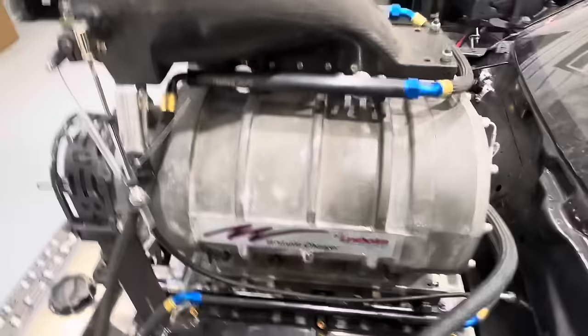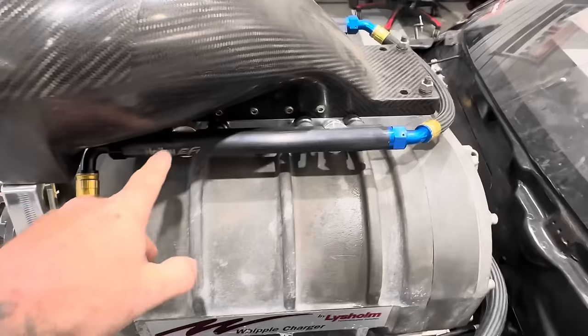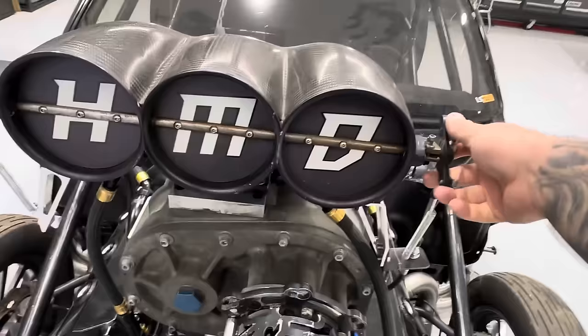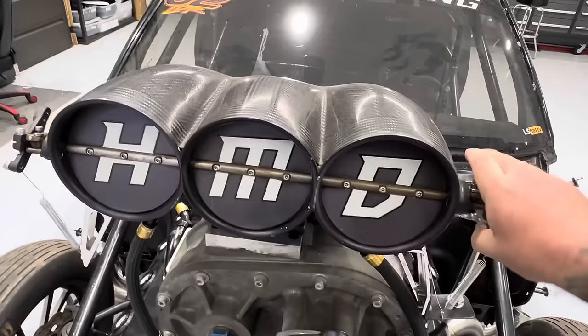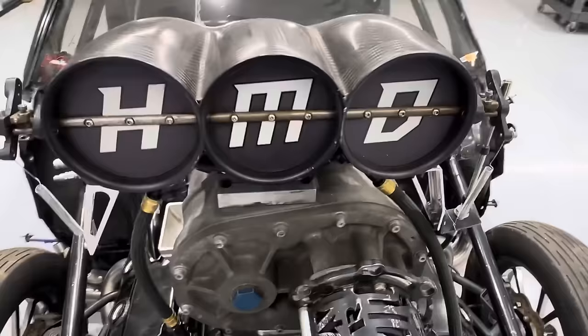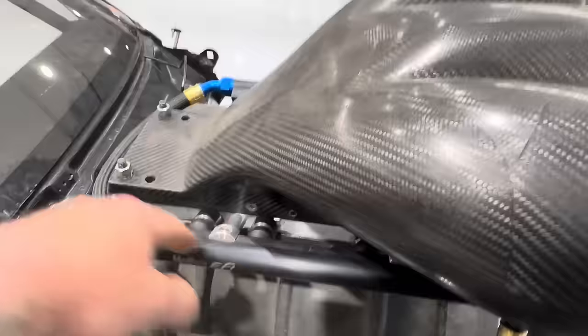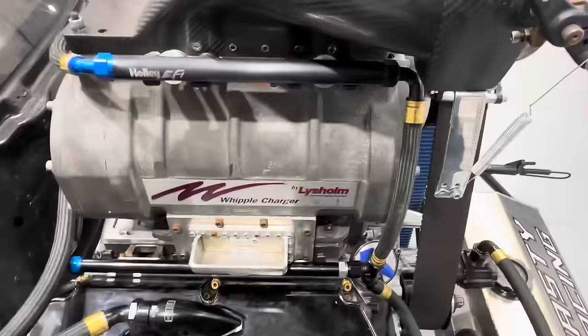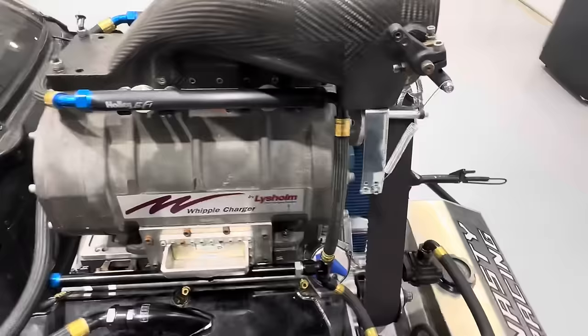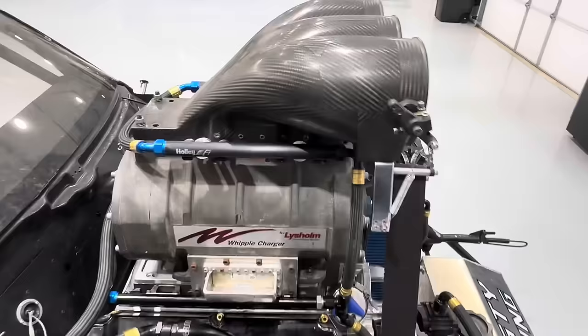What's the purpose of putting a bunch of fuel up there? The biggest thing is we need a ton of fuel for this motor, but it also keeps the blower cool. You've probably seen guys, before they make a pass, open this up and spray a little de-icer or gasoline in here to get them to fire. We're going to use 60% of the fuel flow up here pre-blower and 40% post-blower. The goal is to keep this thing alive — it's going to run very rich. If you watch any videos of blower cars, they fire them up, do the burnout, and you've got basically raw fuel pumping out. You want to keep that thing cool — that's how you make power.